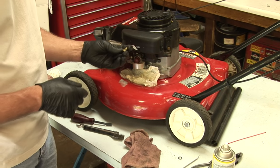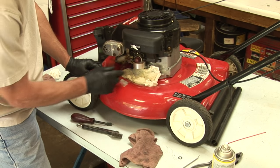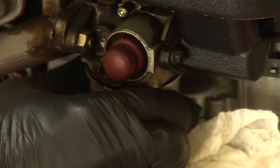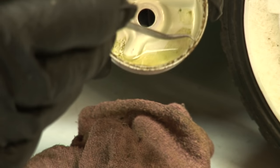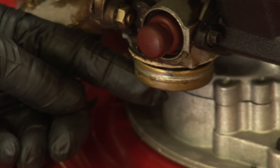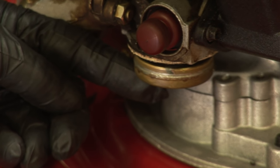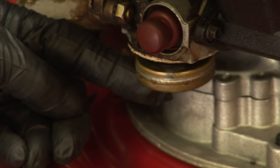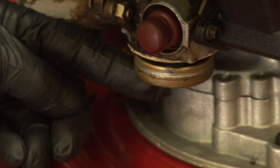Once you're sure you have that main jet clean, set that aside. Now we're going to take the bowl off the carburetor — the bowl is only held on by that nut. Sometimes they get stuck. On this one we're going to replace the bowl, so we're not even going to try to clean it. Make sure that the float is moving freely, and when you bring it up it will have a distinct click. That clicking sound tells you that the needle is sealing on its seat — that's what you want.